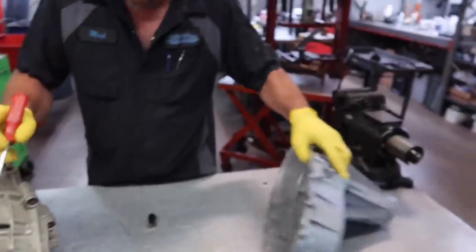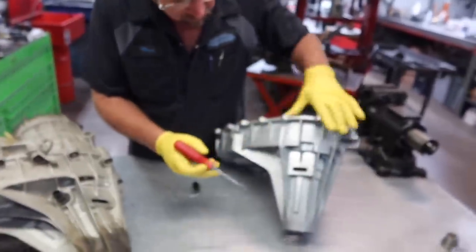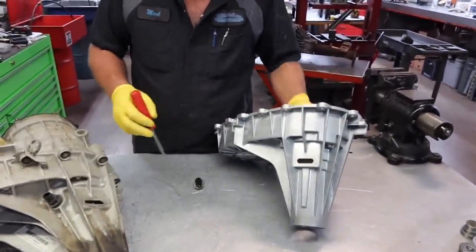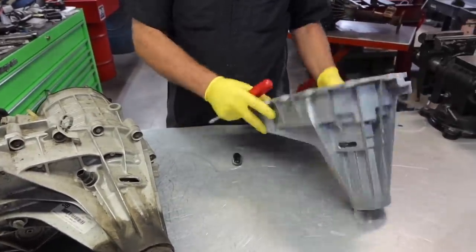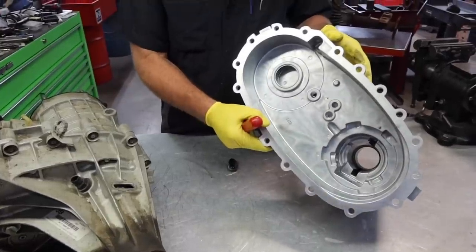Our philosophy here is to throw the magnesium housing away, put a new aluminum rear case half on, and be done with it. I've seen the early ones with the threaded sleeve back off, then they went to a version where they drilled it and put a roll pin in to keep it from spinning — but every one of those I've seen has broken the roll pin and came unhinged again. We'll show you the difference when we get this apart: our brand new aluminum rear has no threaded sleeve, just a snap ring groove with a new bearing bore.